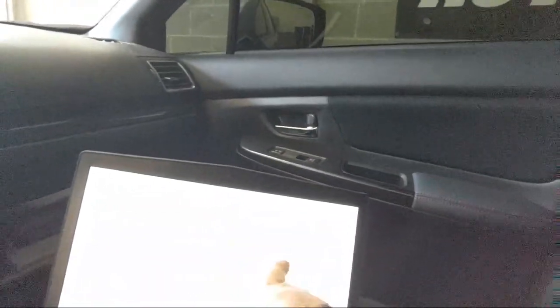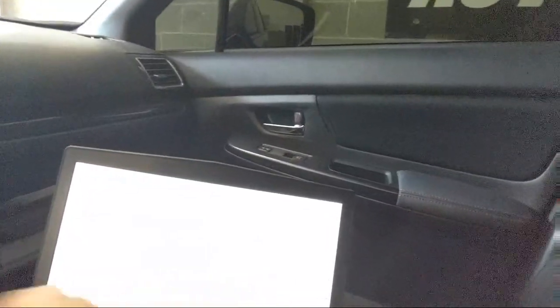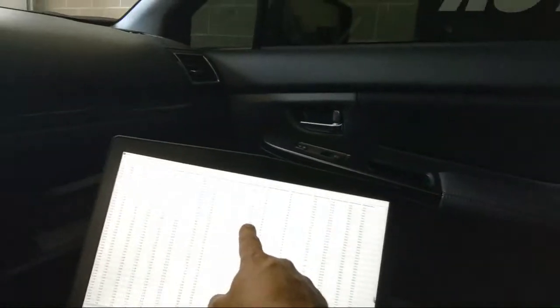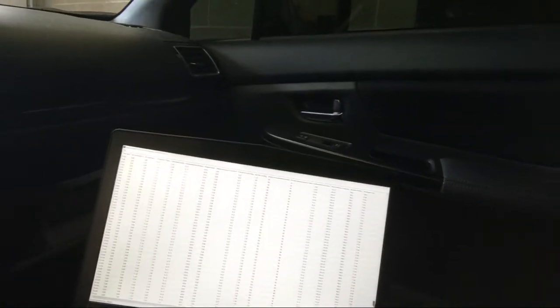But look at that. These things learn to pull timing like crazy. Even when the timing is nothing, the heat is low, 80 degrees. Boost pressure is reasonable. Yet, here's all this learned ignition pull. Now, I can guarantee you that's not real knock. If it is real knock, this guy needs spark plugs and a walnut blast and everything else. But that's just dealing with an FA for you right there. At 0 degrees of timing, I'm knocking at 16 pounds of boost at 5,600 RPM. At 11.5 to 1 AFRs, probably not. Let's just be honest. But that is what the FA does. It's kind of a fickle bitch.